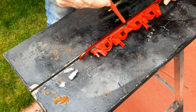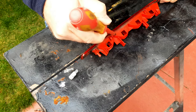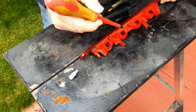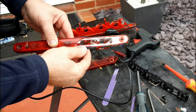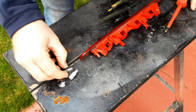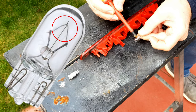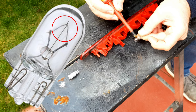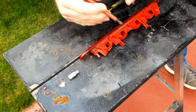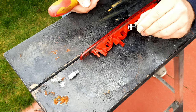These curved pockets are parabola-shaped, and if you look carefully inside, they're aluminium-coated to be reflective — just the same as a reflector headlight. I've split apart an old knackered light so you can see the parabolic reflector inside. These parabolas are designed to take a standard bulb which always has the centre of the filament at the same position, so the centre of the light source is always in the same place, focusing the beam and producing a full beam out of the back of the light.